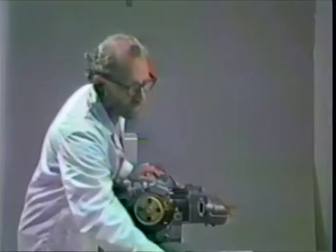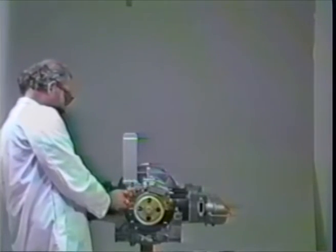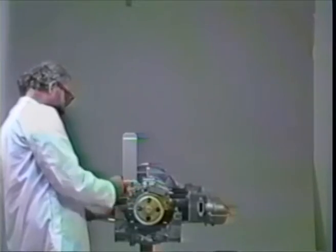The fuel pump, generator stand. We're going to use a C912 fuel pump, so we need this type of insulator block. This is new from Stoddard. Not too expensive, about $5 or so. Note that it's not symmetrical. It goes on only one way. And you can test that out. That's the wrong way, so you want to put it on this way, which is the right way.